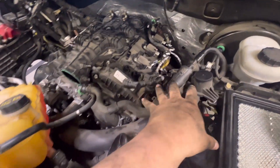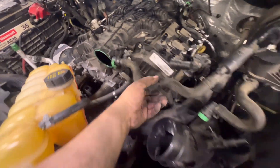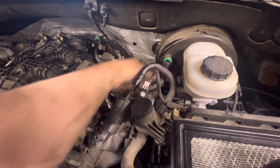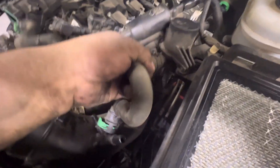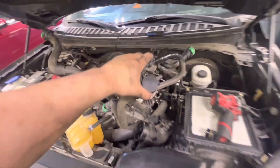These are actually vacuum hoses because they tie into the brake booster. All this comes off as a unit off the intake manifold - one came off the turbo piping, there's an electrical connector, and then your brake booster. It clips into the air box here. Release the vacuum out of the booster - that's what that sound was. Got it - this comes out as a unit as well.